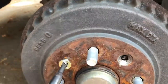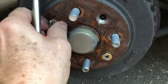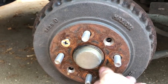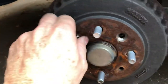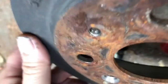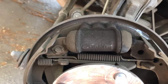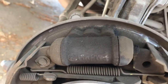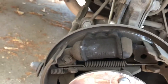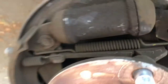On your car it might take the ones with a hex head, but it worked. Now I'm going to pick off the screws and the drum, and I'll talk about what the problem is inside next — the way they adjust their brakes and how you have to take them off. There it is: the infamous system that Kia uses to adjust a brake. That's the brake hydraulic cylinder — this little thing obviously applies pressure from hydraulics, and this long little bar here is the adjusting cam.